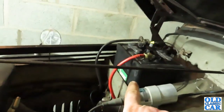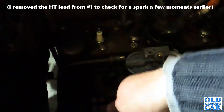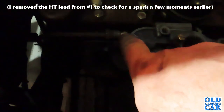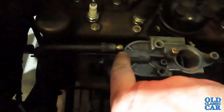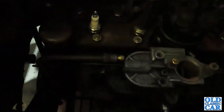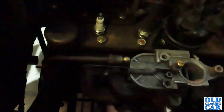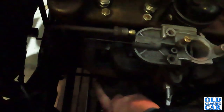But no matter what I do, whether I spin the engine over with another battery on, or do it by hand, no fuel is pumping through the pump. Here, I've disconnected the fuel pipe that goes into the carburettor there, and there's no fuel coming through at all, despite spinning it over on the starter, doing it by hand. I know there's 2 gallons of fuel in the tank, and I know that the line is clear. So either there's a blockage in the fuel pump somewhere, or it's just packed up and it needs an overhaul. So I think it'll have to come off. That'll probably be the next job to do, and that will be in the next video, all being well.